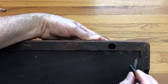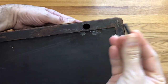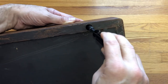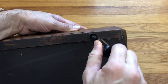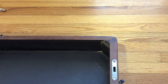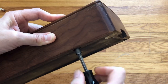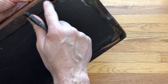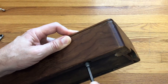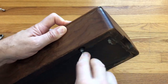Just like we did with the other hinge, let's go in here. Now that I put light on it, maybe you guys can see there's a small hole — the size of this bolt — way down in here. It's significantly countersunk, so I kind of have to go by feel. There we go — I know it's down in there now because it just sank down. Someone had to go in with drill presses and route these holes — this extra care that Singer and other manufacturers gave was because they knew that at some point in the future the machine might need to be overhauled.